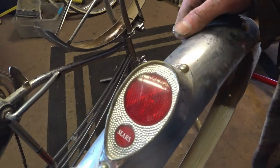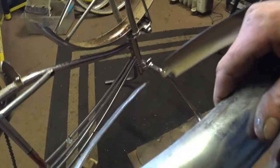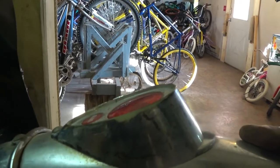You've gotta be careful here — there's a little reflector in the back that we have to preserve. It looks like it's got that plastic silver paint, which most likely will get taken off. I can guarantee that if I put that in the purple power and let it soak for any given time, it's gonna peel that silver right off. So I have to be very careful washing that section — just water, maybe a little mild detergent, not the purple power. This stuff is gnarly; it will cut right through that plastic paint and take it right off.